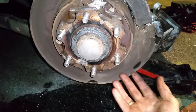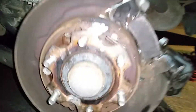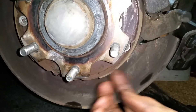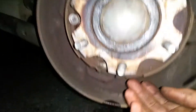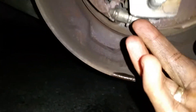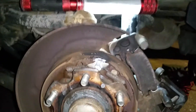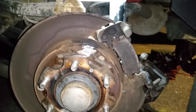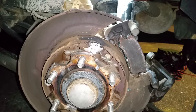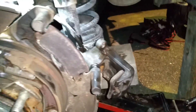Lubricate the hinges, clean the springs, and generally this bottom area will have a lot of dust deposits due to gravity and such. Lubricate the mechanism that's part of the handbrake or parking brake, and also the mechanism that auto-adjusts the pressure on the brake pads according to their wear.